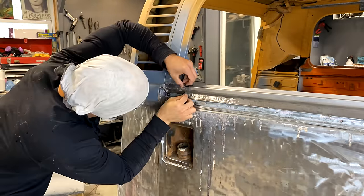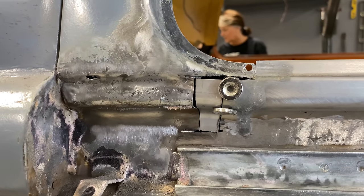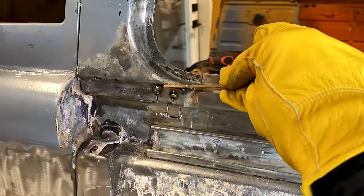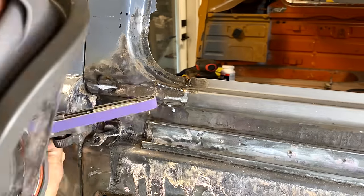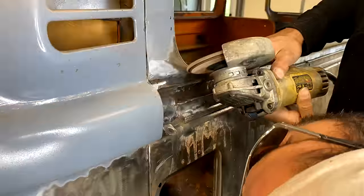This little piece that I'm custom fitting here was due to the fact that when I cut the rail I didn't account for this little extra section. Shout out to Joan in the back, Mallory's mom — she visited and took Mallory to Costco. While this little patch was easy to do, as you can see there's a pretty big gap that I'm filling there, but with a little bit of practice and temperature control you can cross some pretty big gaps and fill holes if you need to. It's taken me a long time to figure out exactly what temperature to not blow a hole through and be able to cross gaps.